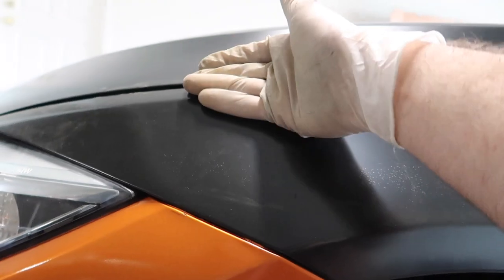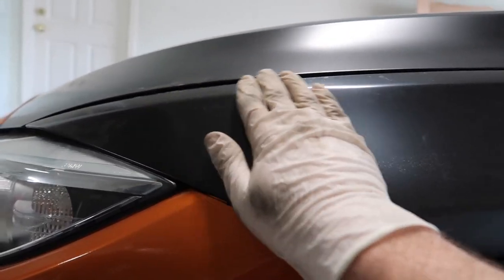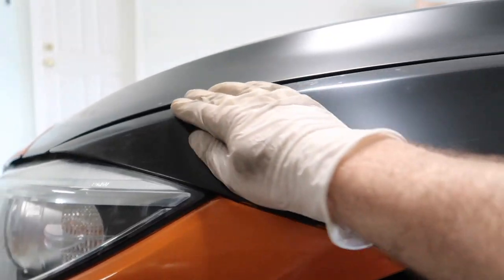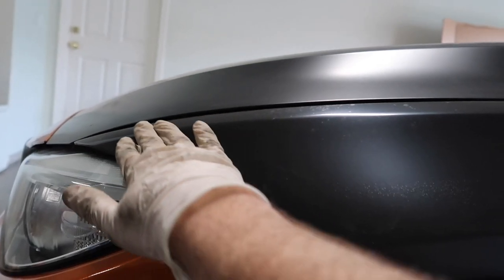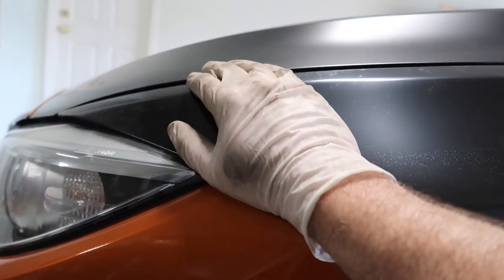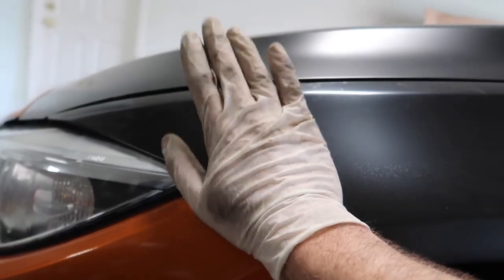I think what I have to do is just bend it up. It is metal, so it's way easier. Just go underneath there, bend it up ever so slightly, and you're fine. Body shops do this stuff all the time, especially if it's metal. They just pretty much roll it, and then they can match it up. Or I can go ahead and just readjust the fender. Either way, this is totally fixable, so I am good.